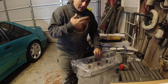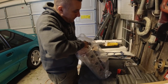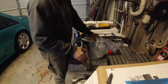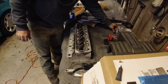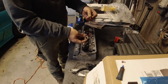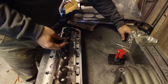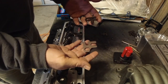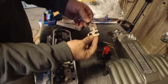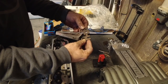I'm a little stuffy — allergies are wearing me out right now, but we're going to push through this. We're going to show you guys how to set up your new heads. You got a set of these SVE heads from LMR — this is what you need to know about them. Me and Andrew both looked at these and were like, what do we do with these? It took us a minute. We finally figured out the combination. Let's go ahead and show you first off how your guide plates work. You got two different styles here — they're going to lock in together like a puzzle. That's where your push rods are going to come through, and you can adjust them in, out, up, and down a little bit.